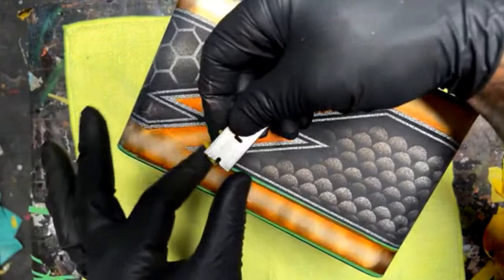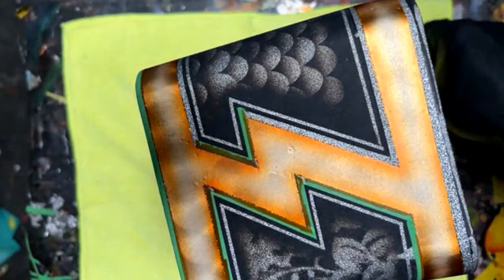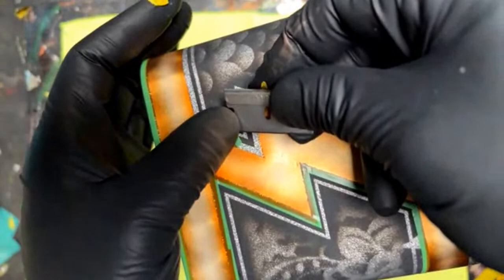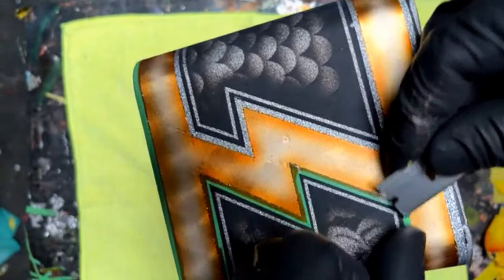I feel like the black base coat mixed in with 2K clear coat is applied with that. And then after you get the flake on to the desired look that you want, you just keep on clear coating it with 2 to 3, maybe even 4 more coats, depending on how you spray, of regular clear coat over the top in the same session. You're doing this all together. Then you let that dry for 12 to 24 hours, depending on the clear coat, and then you sand it smooth. Once you sand it smooth, you're ready to lay your tape lines and go from there.